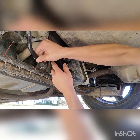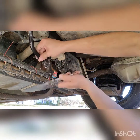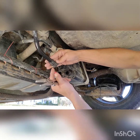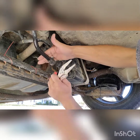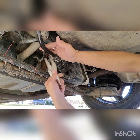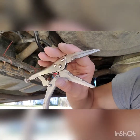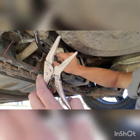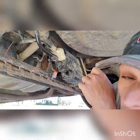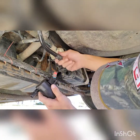Just push this off to the side — see all that dirt kicking out of there. You want to take and tap on that a little bit and clean that out. You want to get that all cleaned out of there so that way when you squeeze these clips it'll come off easier next time. They get full of dirt and junk, and then it's hard to squeeze the clips together. I used needle nose pliers to squeeze mine together and pop it off — got it halfway and then got it out. It's too hard to get them to come off otherwise.